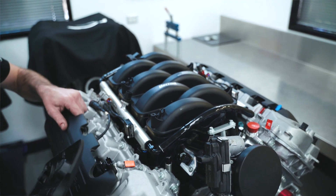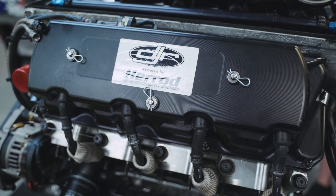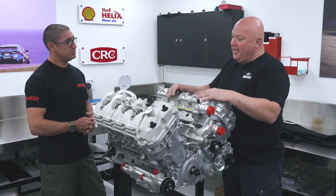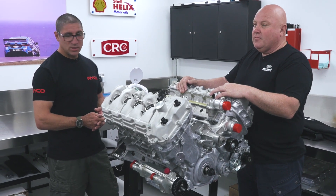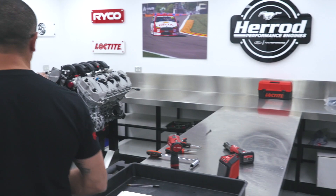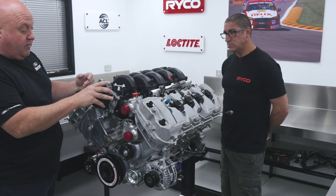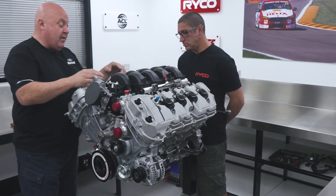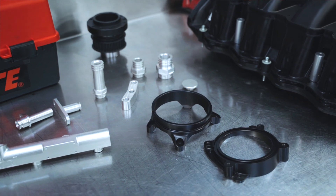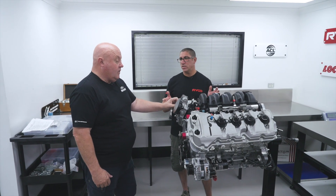The most amazing thing about this engine — because it's majority production parts — is nearly every engine weighs within a few grams of each other. We weigh the complete engine out the back, and they're all within a gram or two. In previous generations you'd never get that because blocks varied. This is all one thing and it all weighs pretty much the same. This complete engine here is back for some servicing — it runs the same inlet manifold you'd get on a Mach 1, a standard Ford 87mm throttle body, our own fuel rails which hold the Motec ignition system.